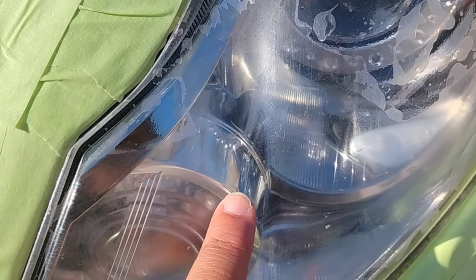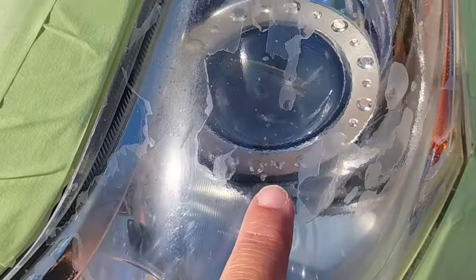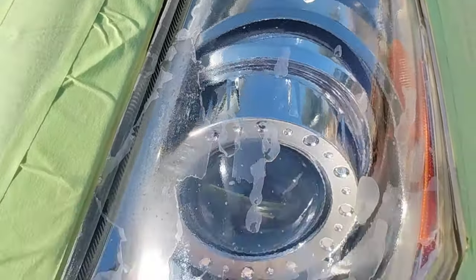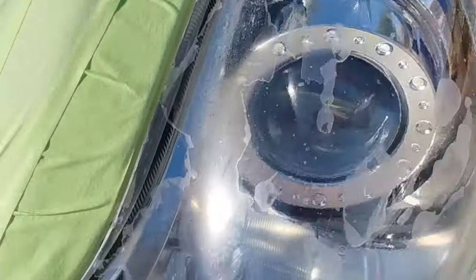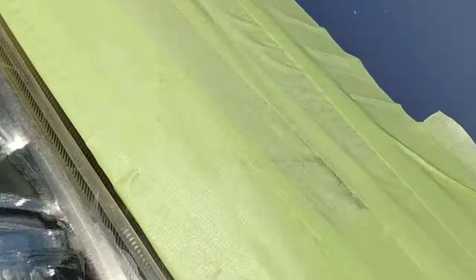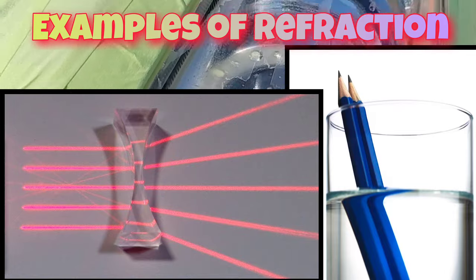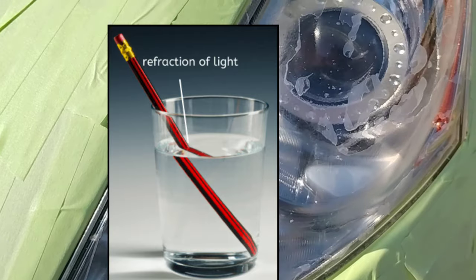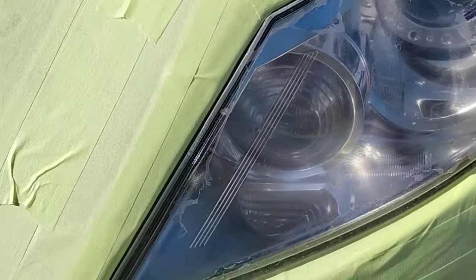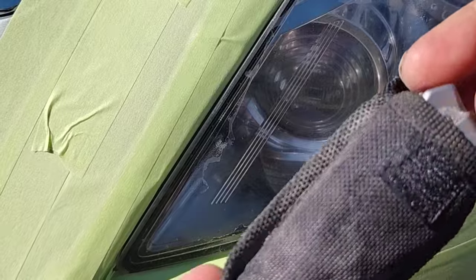As you see here, it's all spotted and patchy and looks weird. The existing clear that's on there looks shimmery or weird — that is the effect of refracting. In layman's terms, it's light being reflected in different ways. The light isn't just passing through the substance. If you hold up a piece of glass, it's just clear and flawless — no ripples. That is what happens when you use something not designed for headlights.